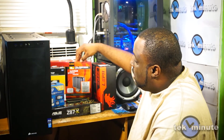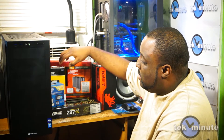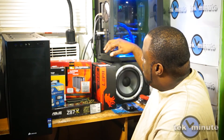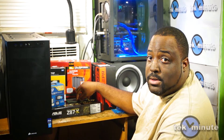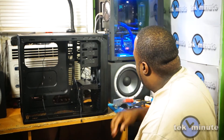Hello internet, I'm back with another build video. Today we will be building a music creation center Hackintosh. These are the parts we will be using: a Corsair 200R case, a PC cooler made by Silence, a WD Caviar Green 2TB hard drive, an Intel Core i5 processor with LGA 1150 socket, a LEPA 500-watt power supply, a Patriot 8GB kit — two 4GB sticks at 1600MHz — and an ASUS Z87K motherboard.